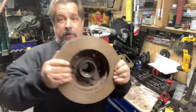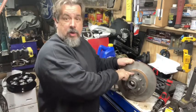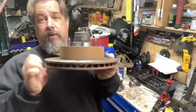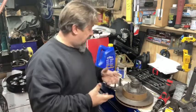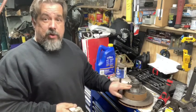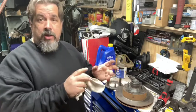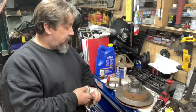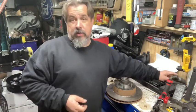What I did was — you can see where I machined it — so that the studs, when you put them in, they sit flat and they don't come out at an angle. You also need to machine this hub down so your wheel will fit over it, you can see right there. I did all this on the brake lathe. I know not everybody has a brake lathe, and I unfortunately don't have a big lathe, so I improvised and used my brake lathe. I knocked all the studs out, used the brake lathe with the brake arbor, hillbilly engineered it, and was able to cut a little bit off the inside to give me a flat surface to put my studs back through. The outcome — perfect. Far as I can tell, everything's going to work really well.